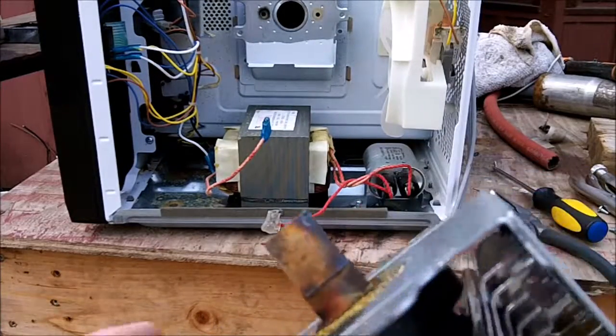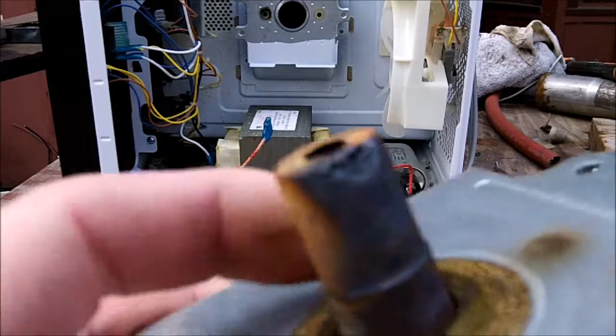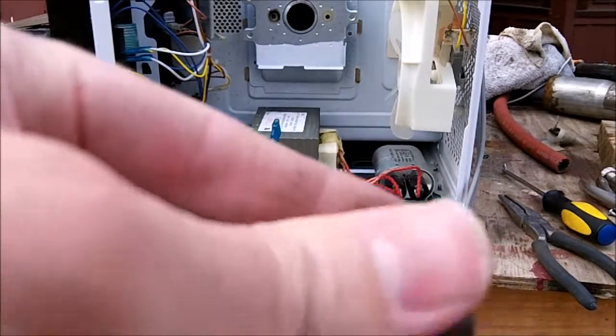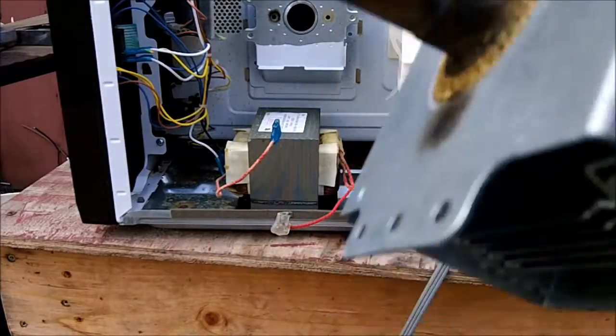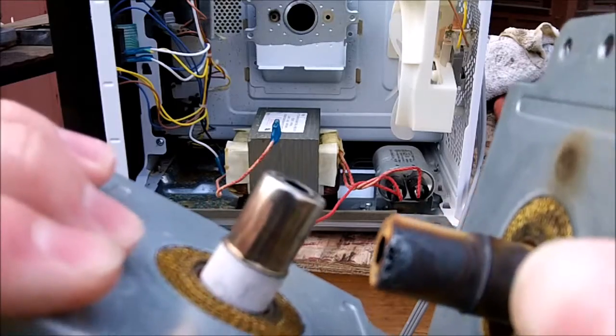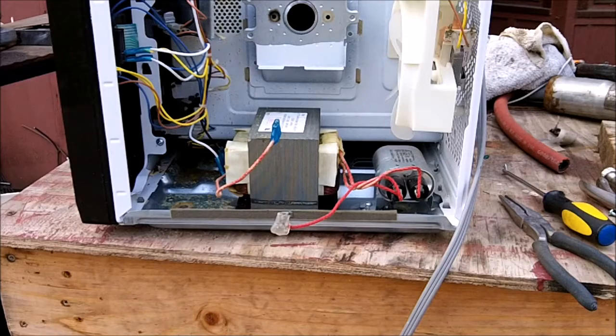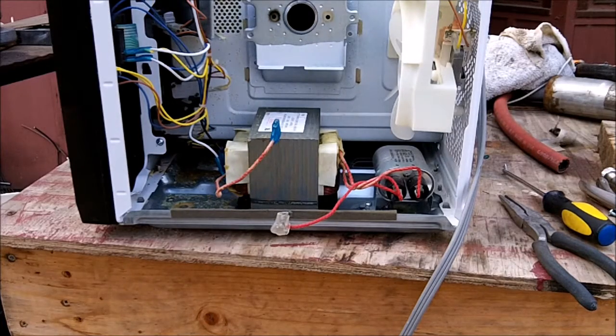Here's the old magnetron out. The tip where it goes into the microwave — you can see it's got a hole burned through it, and it has some soot. You can tell it's been exposed to a lot of heat. This is what a healthy one should look like. I'm guessing that happened because someone was having fun with this microwave, microwaving stuff in it, overloaded it, and burned it out.